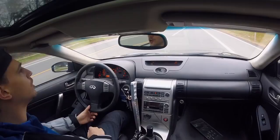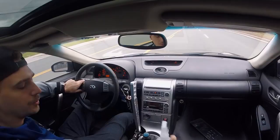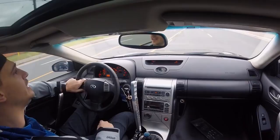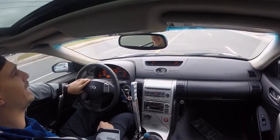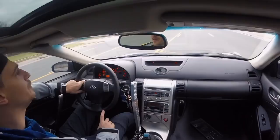I did end up getting some of the Chemical Guys wrap detailer spray — this thing was nice and it smells delicious. Picked it up off their website during their Black Friday sale. The whole rear end on the car has solid aluminum bushings all around from Sikky, including the differential, so the rear end's pretty solid. I got PBM rear toe arms and I think another camber arm back there too. I'm looking into upgrading the front end over the winter.